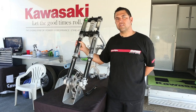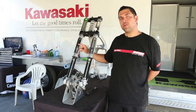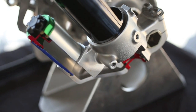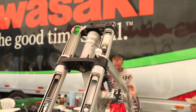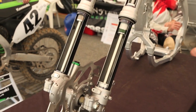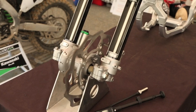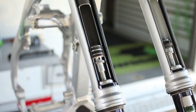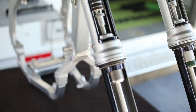It's all controlled by air. We have the inner chamber, we have an outer chamber, and we have a negative chamber. The negative chamber is to offset the two pressures that are on the inside and the outside. Basically, if you filled this fork with just inner air, it would be too rigid to ride. So the negative pressure helps give you the initial plushness that you need for a hard track, a loamy track. You can adjust that per track, per rider weight, per ability.